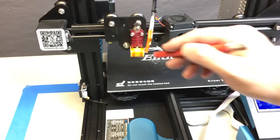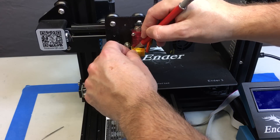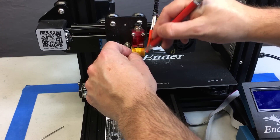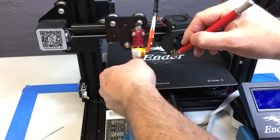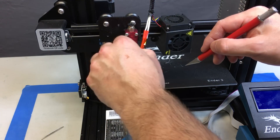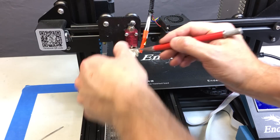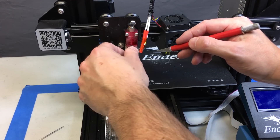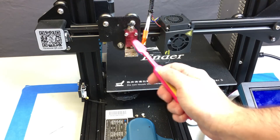While this thing has cooled off, I've taken a look at my insulation and mine's looking pretty flaky, so I'm going to replace mine. You can skip this step — it has nothing to do with unclogging your nozzle. But I'm going to do mine in case this is an upgrade any of you would like to do. The stock insulation is just held in place with some yellow Kapton tape — just cut through it with an exacto knife on the left-hand side, away from the wires, and clean that old insulation off.